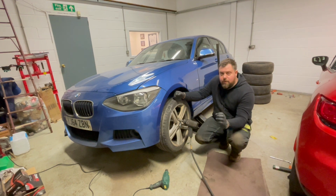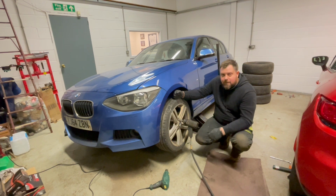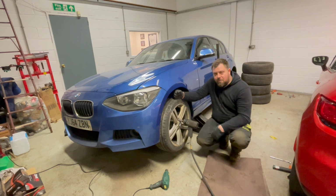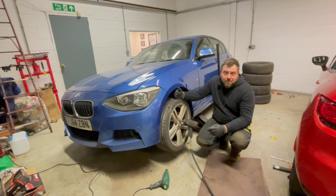The last coat of lacquer has just went on the Toyota bumper again. I've sprayed it with the Magic Pixie Dust blender, so we'll see how that goes. And in the morning when it's completely dry, we'll get a look and see if this colour matches any better. Pop the bumper back on, and hopefully that'll be that one done as well. So I'll see you in the morning.